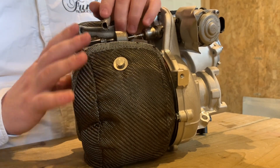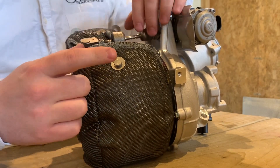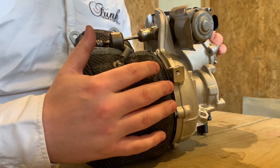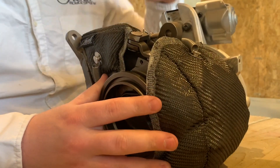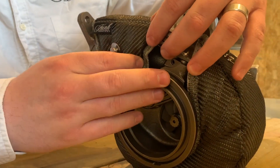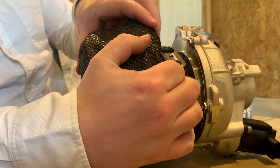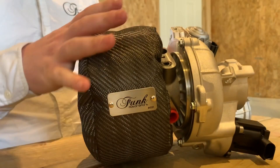Now that brings us back to the spring on top which we fastened in place earlier. That's going to go underneath — it's very important it does go underneath — secured underneath the actuator arm and fastened to this metal tab. Once that is in place, it's just a case of manipulating the blanket onto the turbo to make sure it doesn't interfere with any of those lines. You want to ensure it's not interfering with the down pipe fixing points, and push that out of the way. If this is fitted to the car already, it'll be a little bit easier as the oil lines and coolant return lines will already be in place. You just want to make sure you can see those gaps all the way around.